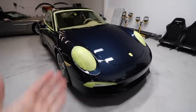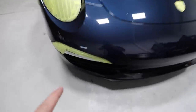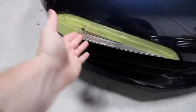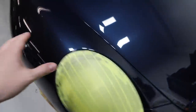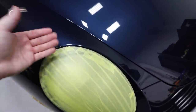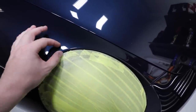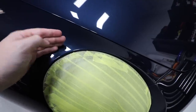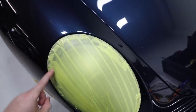The front end is pretty much taped off — it looks kind of funny actually. We've got the emblem all taped off, the headlights fully taped off, part of the fog light here. The whole point of taping all this off is so when you're polishing the area around plastics, chrome, or anything like that, you're protecting the pad from coming over top of that. Because when you're polishing, you're not going to stop right on that line — you're going to overlap, that's just the tendency.